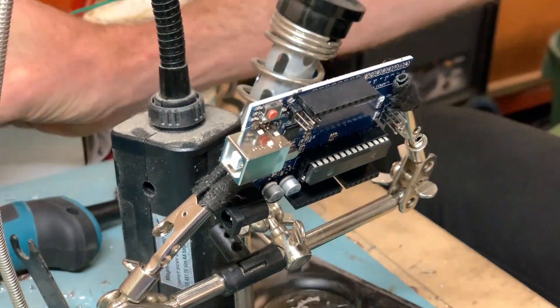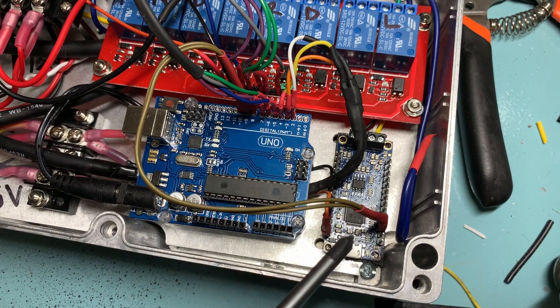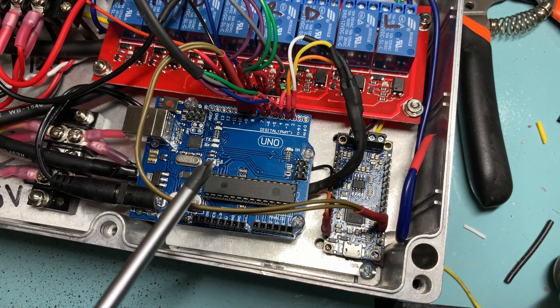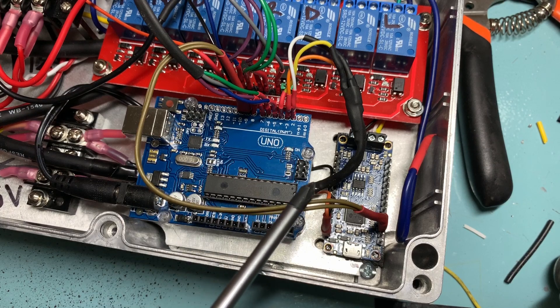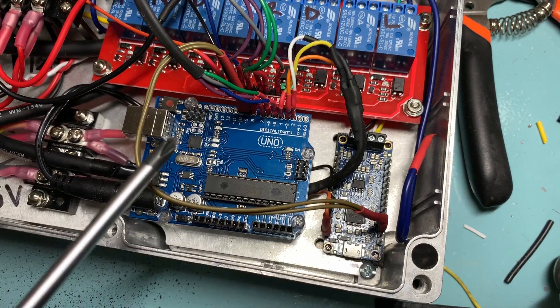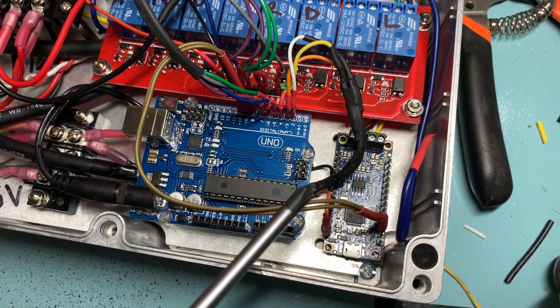This chipset here is an integrated sound processor and amplifier. With these two brown wires, I'm triggering one of two sound effects that then go out and make a nice little sound when the car gets turned on. Often when you're getting into a modern electric car, you wonder: is it ready to drive? That was really important for us — when the car itself is silent when turned on, what signals good to drive? So this both triggers a light through this relay and a sound file in parallel, which is just a nice thing to be able to do.